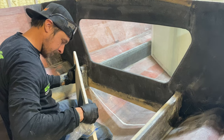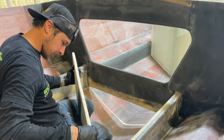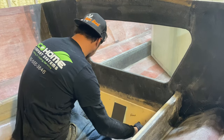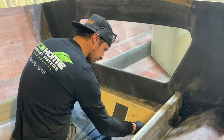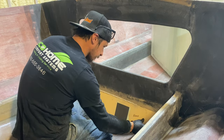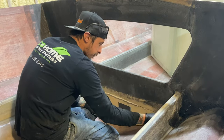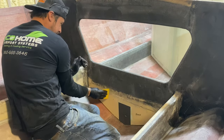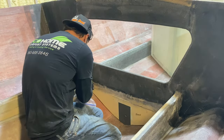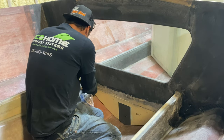After we decided, we cut out the piece that was missing. You can see that we used five pound and twenty-five pound board. The twenty-five pound board is the black square that you see. We used a piece of twenty-five pound board in the five pound board so that where our fitting came into the ballast tank there was a more dense piece of core to prevent any leakages.